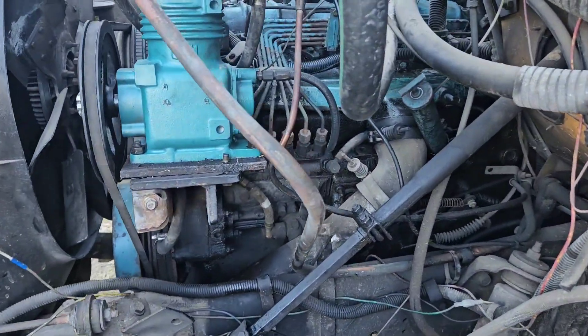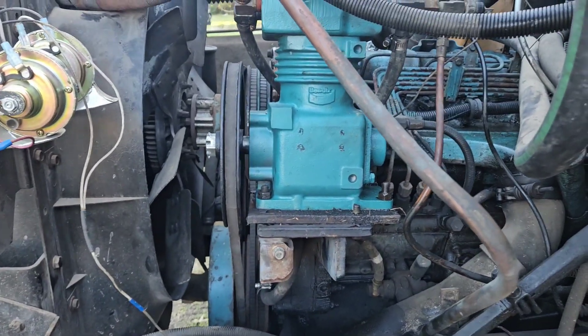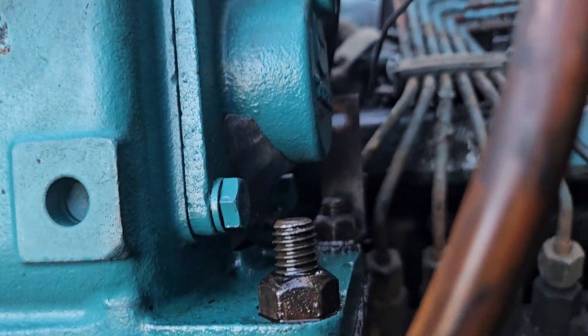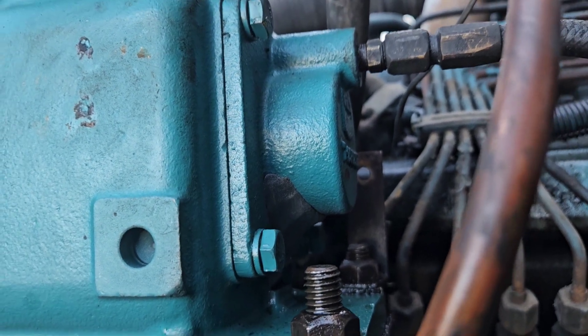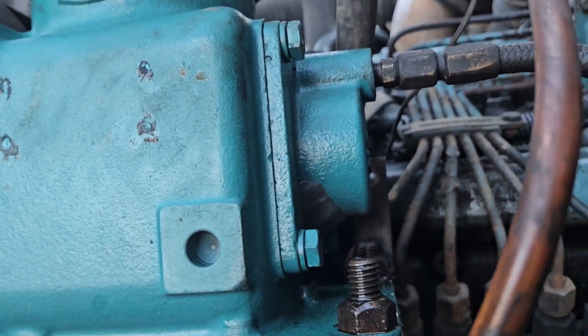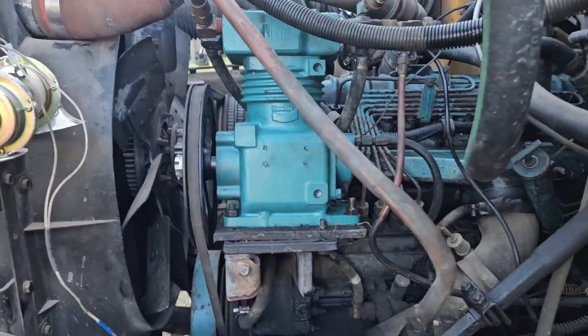Alright YouTube, it's another day, another week, and there's our new compressor. We actually had some issues with it. If you notice back here, it's super oily, and that is because — if you look down here below — this is the crankshaft bearing cover. There was a hairline crack in there, so this thing has been dropped once. That is JB Weld Putty and it works great — works freaking phenomenal.